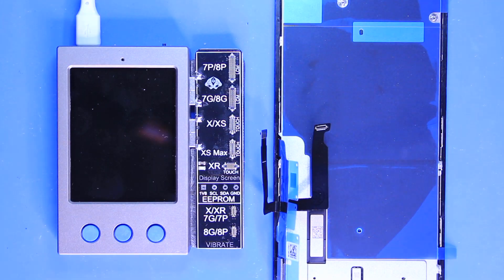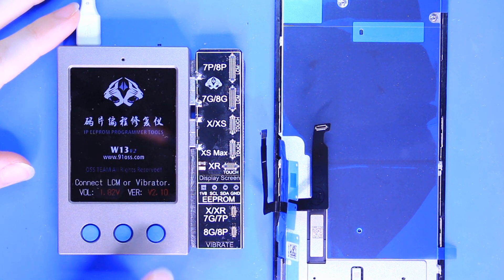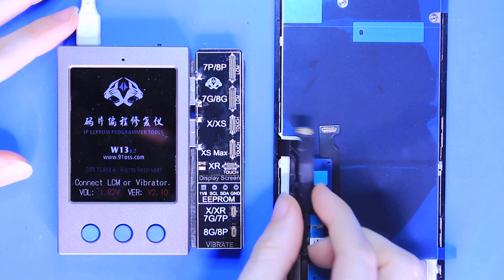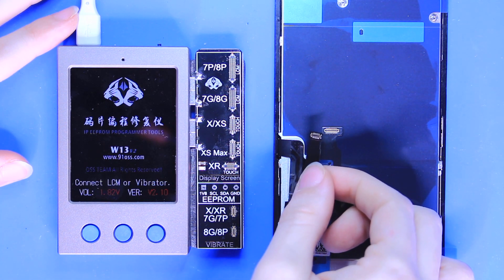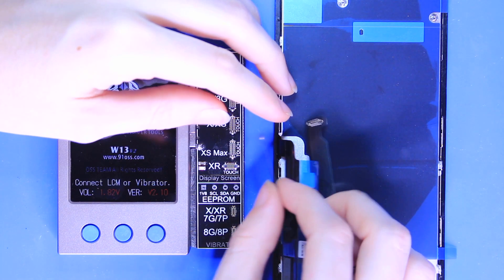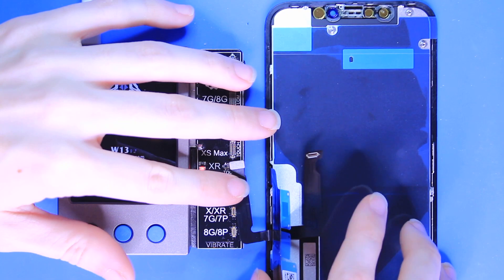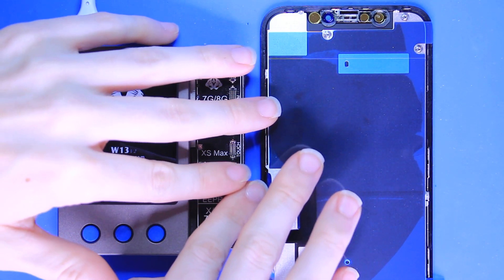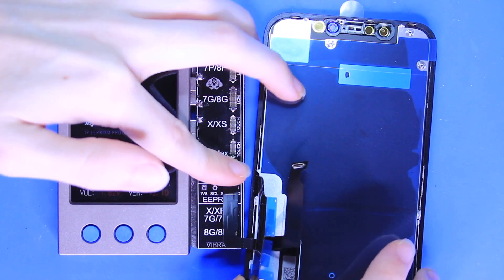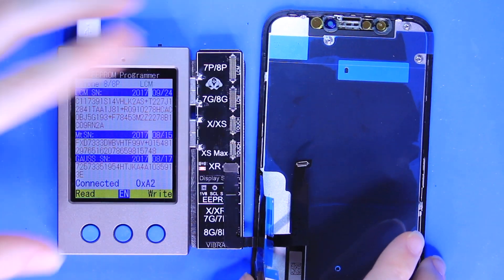But I'm not familiar with exactly which ones, so for this specific model it does need to be an OEM screen that you are transferring the serial to. Once we have our EEPROM turned back on, we can go ahead and take the connectors from this new screen and plug it in on our EEPROM board. You should notice both times that it automatically shows a response on the EEPROM — that's also a way to tell if you're using an aftermarket or an OEM screen.